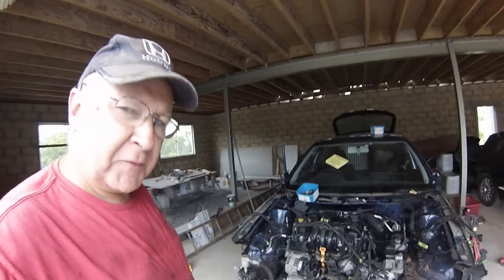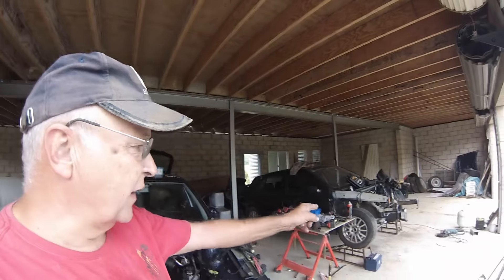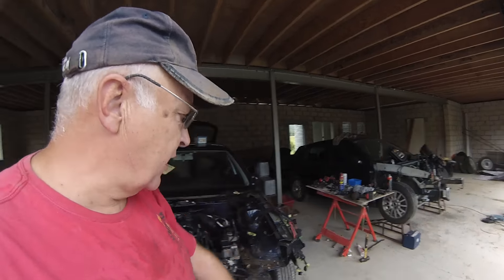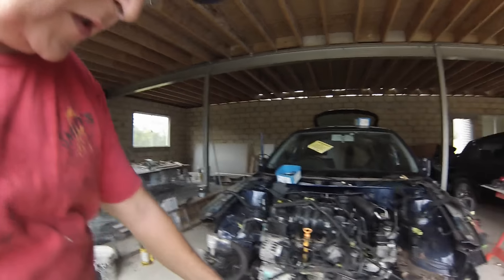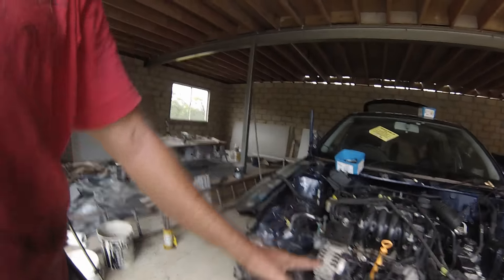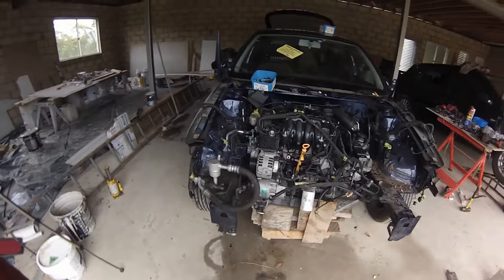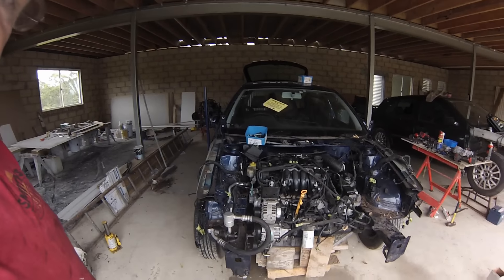With the Mark 4 Golf there's truly more than one way to skin a cat. Remember when I took the engine out of the 2-litre - I dropped it onto my hydraulic lifting table and then lowered the table and pulled the engine out the front. That trolley's still tied up with that motor sitting on it, so I've got just a standard little engine dolly - just a platform with four casters on it - and I've screwed and chocked bits of wood to support the engine and undone all the engine mounts. So that engine is now sitting on that trolley and I'm going to jack the car up and pull the engine forward.